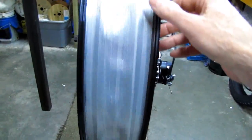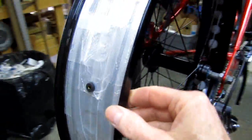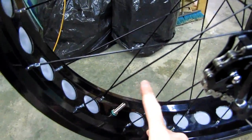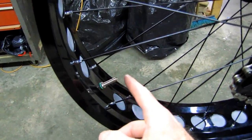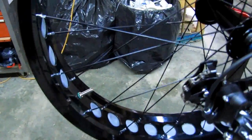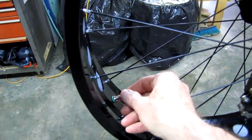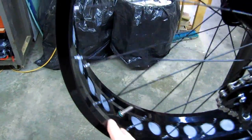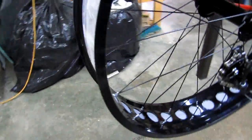I'm going to pop the bead first with a hundred pounds of pressure, and that's why I don't put the center valve core in — my compressor is set at about a hundred pounds. I can pop it on there and it should pop the tire bead out. I'll just check to make sure the bead seats well before I pour the Stans in. So that's next — I'll get back to you in a minute.